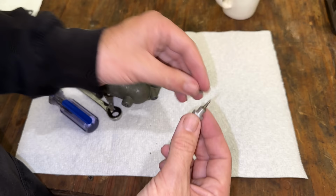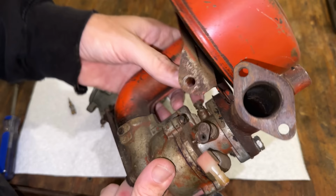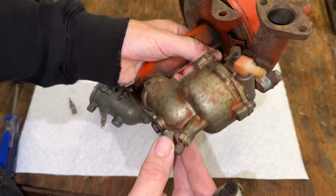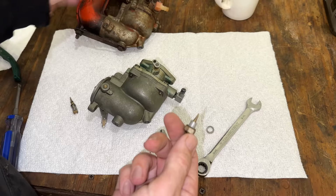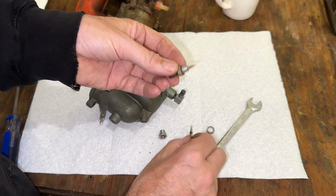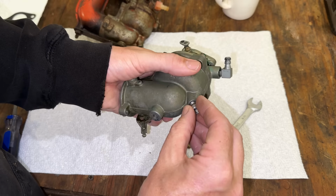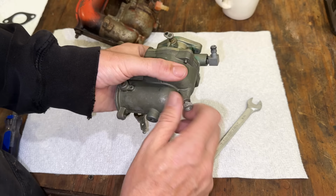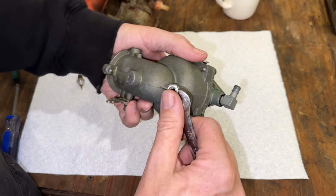Let me see if I have anything I can substitute. So I do have a couple other FloJet carburetors. This one was given to me actually by a local subscriber. I think it has the O-ring that we need. It does, and actually the needle, I was going to say it looks cleaner, but it seems to be a different length. So we'll just take the gasket, assuming it comes off. Yep. Move it over here. And try this again. Hopefully it doesn't kind of blow apart like the last one. And I kind of doubt this was the right part either. It just doesn't look right. So it might have been a homemade gasket of some sort.